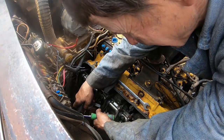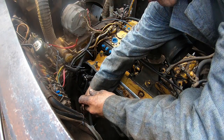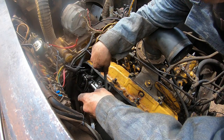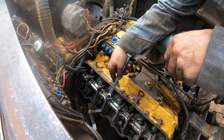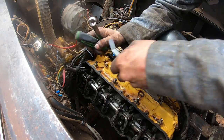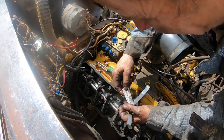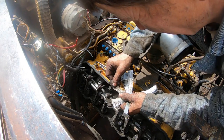The intakes are gonna be on the back side of that cylinder. I was watching a guy on the internet do a valve adjustment the other day and he was torquing these down with a torque wrench and he wasn't even holding the center screw. He was pulling about as hard as he could to get the feeler gauge out from under it. It's not gonna be very accurate if you don't hold the center - it's gonna turn on you. You kind of need to hold the center there, make sure it doesn't cinch down tight on you.